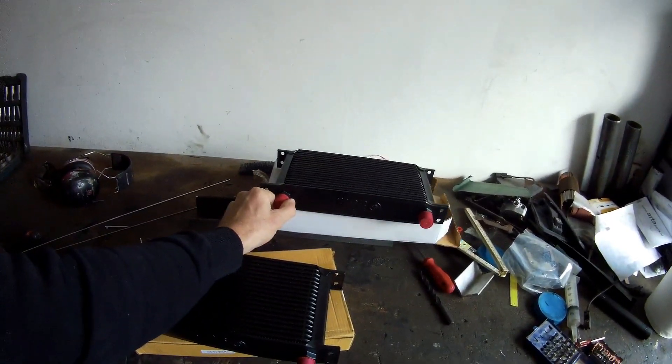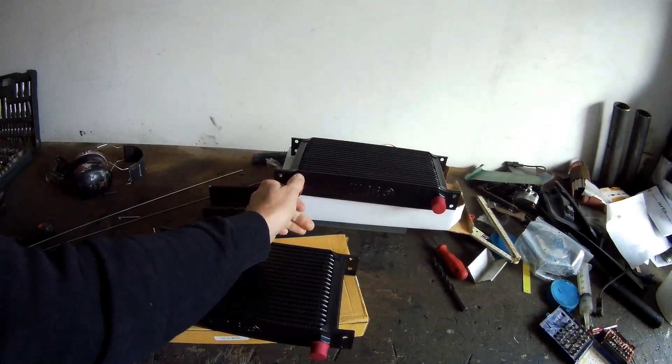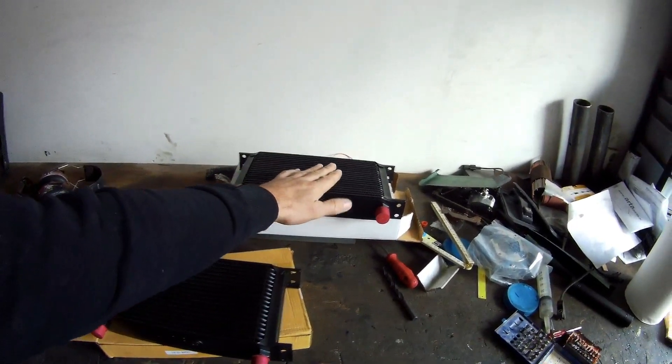This is AN10 connections — that's the oil cooler I'm going to use for the engine oil. I'm going to separate that cooler system, the same as on a compressor engine like the SL55 and E55. The compressor engine has a separate oil cooler in a different place. Those parts are for sale but they're very expensive, so I'm going to do it a different way.